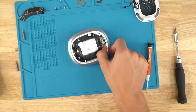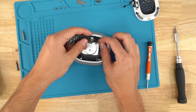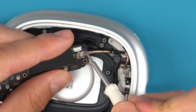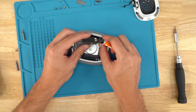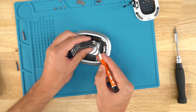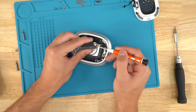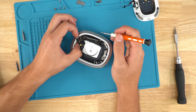Now let's plug in the Bluetooth board to the headband jack. I'm going to align it, not push it in yet, and then push it in with the flathead. The reason you do this is because if you push in the headband jack directly, this metal part is strong but the wire isn't — the wire bends up or down and it's very easy to break it. I've done that before, so now you don't have to.